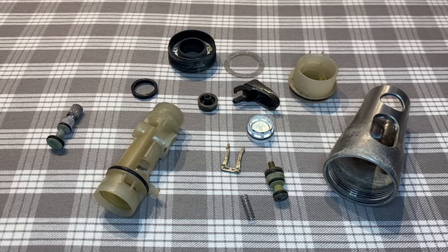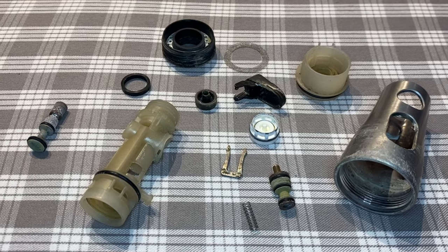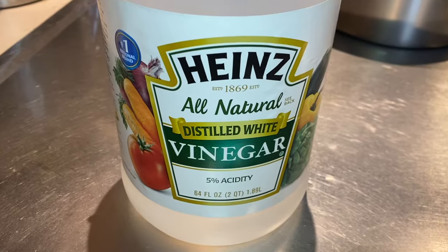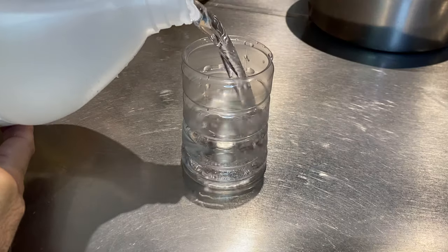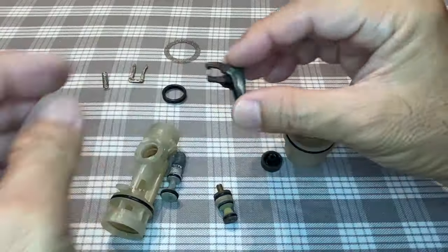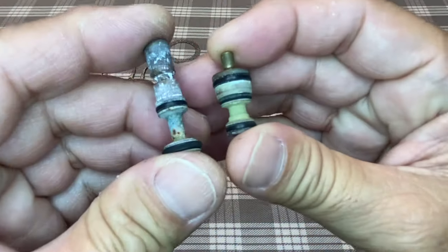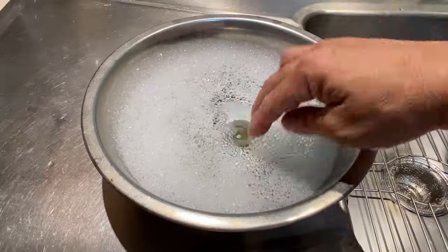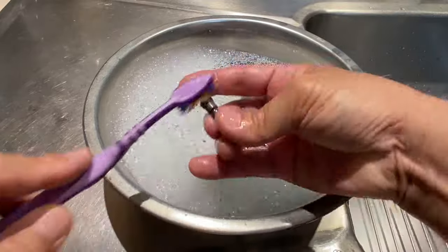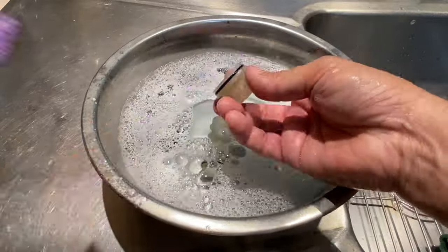And here are all the disassembled parts. The plastic nozzle plate and valve shell were placed in white distilled vinegar to remove the heavy mineral buildup. I read that vinegar eats away at rubber, so the parts with rubber items were soaked in dish soap and water for several minutes and then scrubbed clean. I could have removed the rubber o-rings but wanted to avoid the chance of stretching out any of them.